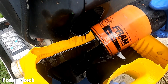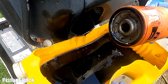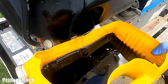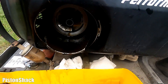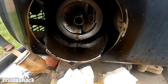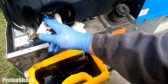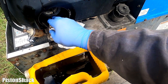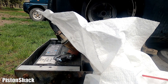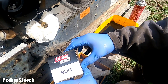The rubber gasket is on the filter — that's good. Now a very important part: make sure you don't have a gasket stuck to the oil filter housing. That can happen sometimes. Check it out — it's nice and clean, good. Let's clean the oil drain area right here, making sure it's nice and clean. Apply some cleaner to a clean paper towel and wipe the housing very well.